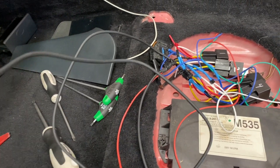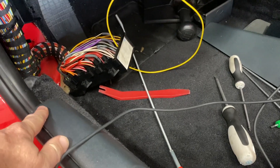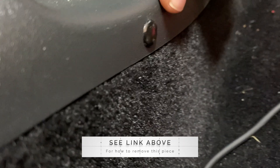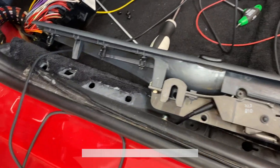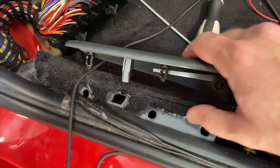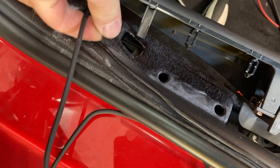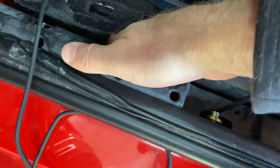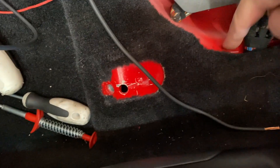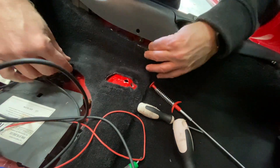My plan for the big wire coming out of here that goes to the fuse is to run it up under the carpet and along the door sill right to the fuse panel. I have to take the door sill trim off — I see three plastic clips to pop out. Now that I have it pulled out and see how tight it is, there's really not a lot of room for my thick wire, so I'm going to peel the carpet back and tuck the wire all the way down to the floor, running along the floor and then into the fuse panel area.